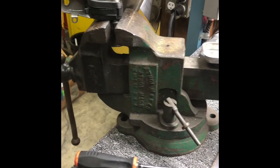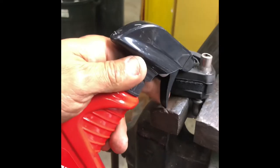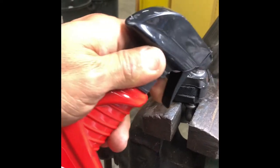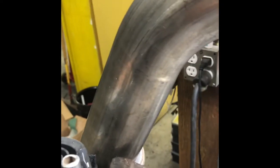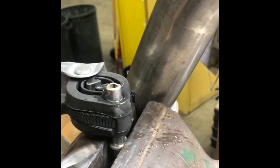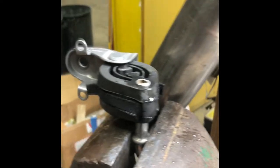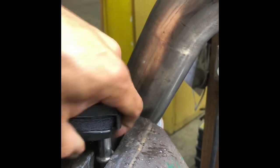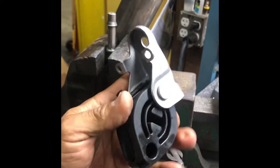After pulling the exhaust piece, it's easiest to put it on a vice and clamp it right on that ball nice and firm. Then take a little bit of lubricant — in this case something like final inspection, not crazy lubricant, but it gives a little lubrication. Basically, just push up on it without breaking the rubber around it and, as you can see, it comes right off. Finally just take it off with your hand — that's all it takes. This is a piece we need to retain and reinstall on the car. No damage.